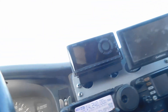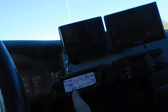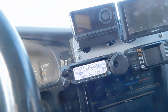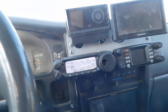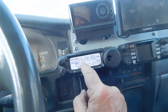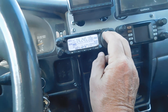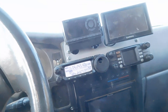We are currently on the Tar Heel. I noticed it doesn't receive well on that frequency — it's just a mismatch; the antenna isn't long enough or something isn't right. So if I wanted to tune the 40-meter band, I would have to go section by section — to the 50s, to the 60s — and tune every one of those sections. I'm going to put it back on the 102.